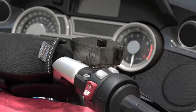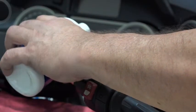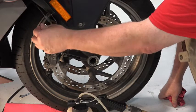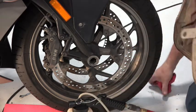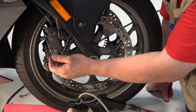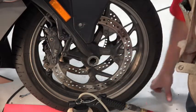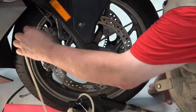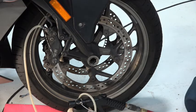I'm going to go ahead and fill it up now with some DOT 4. I'll remove the rubber cap here — the rubber cap's out of there — and I'm going to need to break this loose. Now, depending on how rough these things are, sometimes it helps a little bit if you attempt to tighten it before you loosen it, sometimes it doesn't. That's something I used to get into the habit of doing. That cracked loose — that's good. There's a little bit of fluid starting to come out. In some cases you can gravity bleed brake systems without the use of pressure at the reservoir or vacuums.